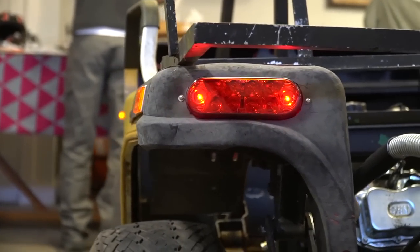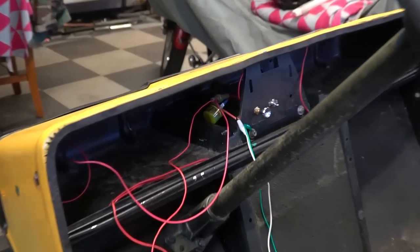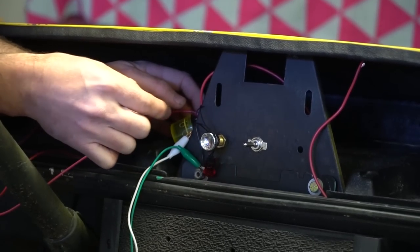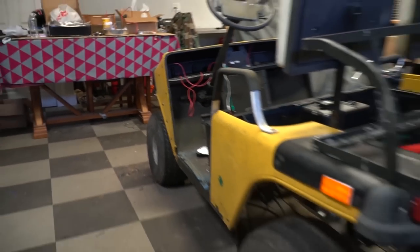Here's exactly what we were worried about — the turn signal's on but we're getting very little blinkage. It's because the LEDs aren't pulling enough amperage to really set off the turn signal unit. We need to install another light somewhere, like an indicator on the dash. Don't you hate getting behind someone whose turn signal has been going for five or ten miles? We'd like to know about it. We just needed three lights — that did it. The box is making a lot more noise too. Oh, that's perfect.